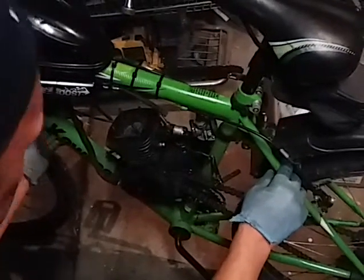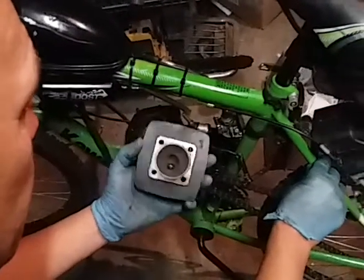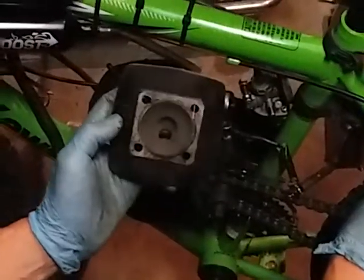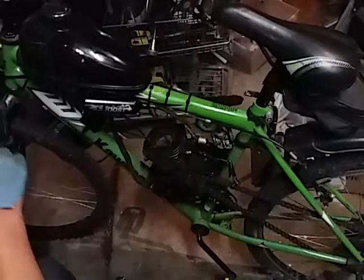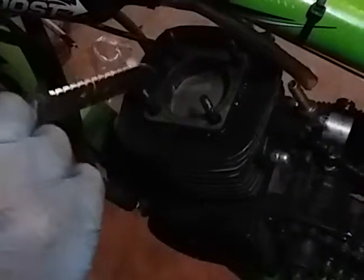Okay, here is your motor. I took the head off, and this is kind of evidence that this has been burning really lean, like I was saying. If straight gas is burned in here in the gas tank without a proper oil mixture...